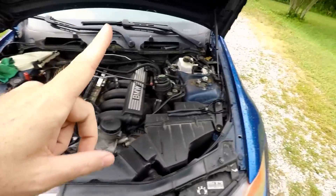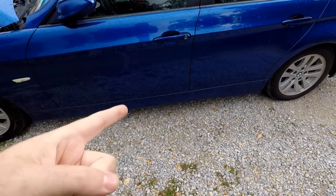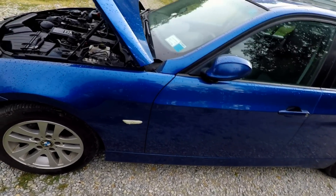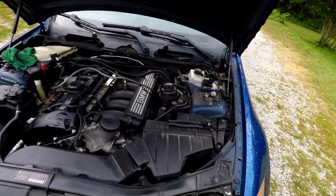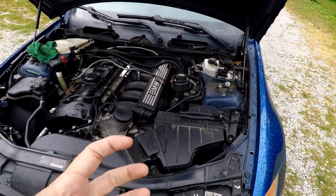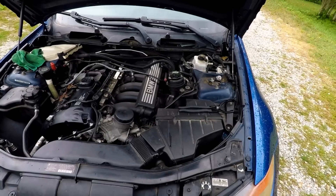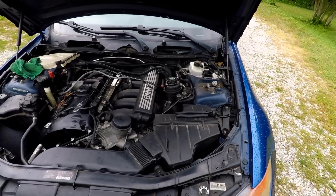If the car is all-wheel drive, has the transfer case been checked? Does it have the right fluid? These take ATF in the transfer case. Next, the transmission — has it ever been serviced? I like to change the transmission fluid about every 50,000 miles, maybe 40,000 depending on your driving. The transmission pan has a filter installed in it and you can't take it apart — you have to buy a whole new pan. They used to be really expensive, but now they're about $30 to $40 off eBay. If you have to pay a shop, the transmission fluid and filter change is going to cost you probably $600 to $700 or more.